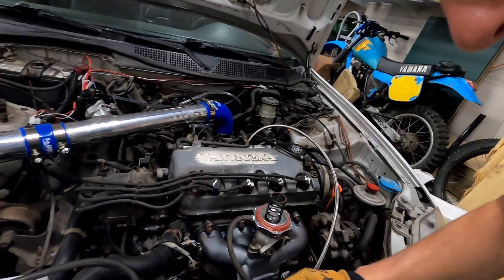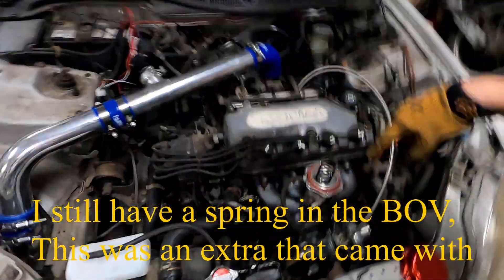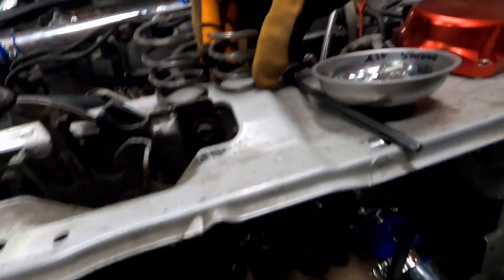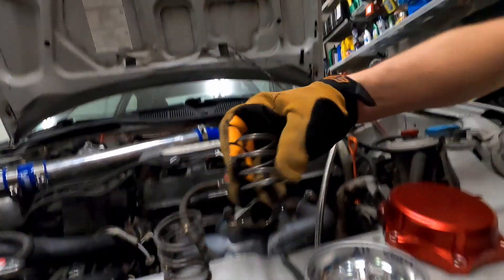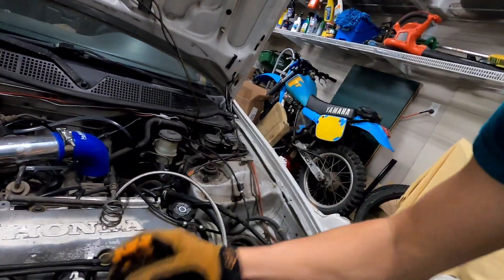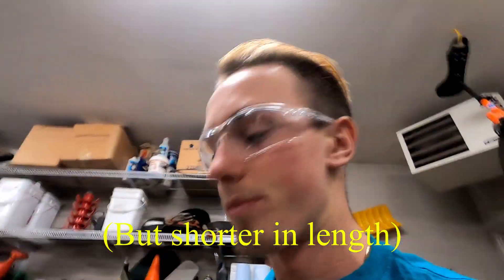What I did here is I cut in half what I think is an 11-pound spring from the blow-off valve — a 50-mil Mamba blow-off valve. I don't know if these springs are supposed to be interchangeable from blow-off valve to wastegate, but I cut it in kind of a one-third and two-thirds segment, and I'm going to use the one-third. It's actually a thicker spring rate than the eight-pound, but we're going to see if it works.